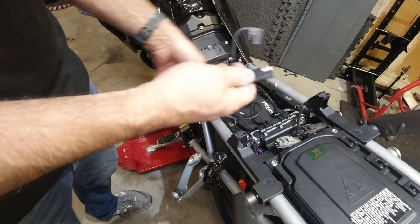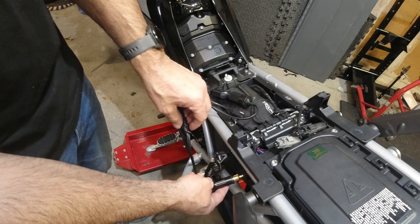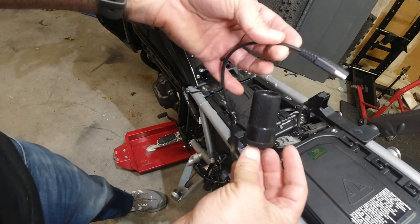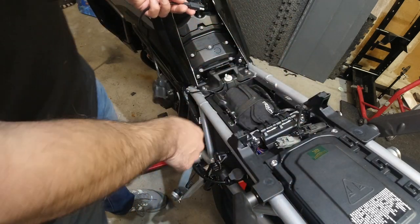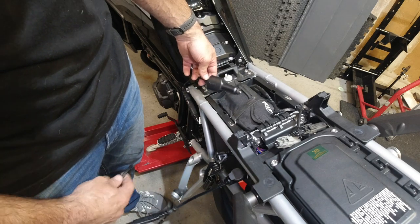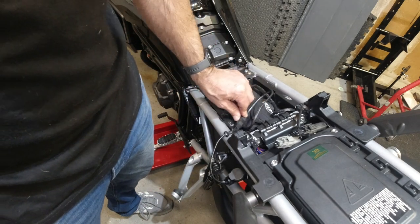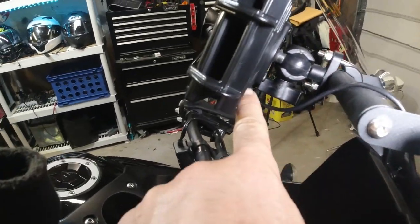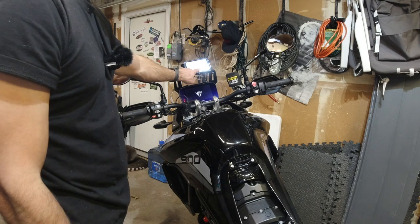Under the seat I've got a power adapter — I got this on Amazon, links are in the description below. It has an SAE connector on one end that plugs into the bike's outlet under the seat. Then I have one of these SAE-to-12-volt plug adapters — you can get these at Harbor Freight, they come in all different kits. Plug that in and now I've got a 12 volt adapter, just like what you'd plug into a car power outlet — switched power. I tuck it in here where the tool kit goes, run the wire up to my GPS, plug it in, turn the bike on, and the screen and GPS come right on.